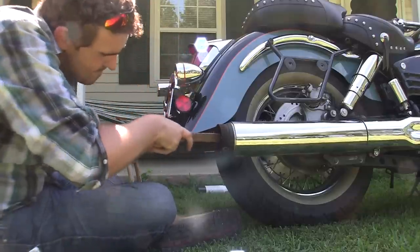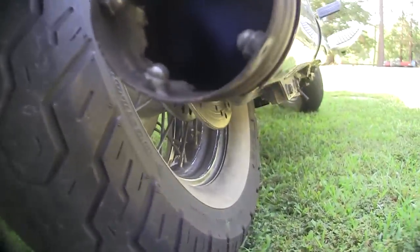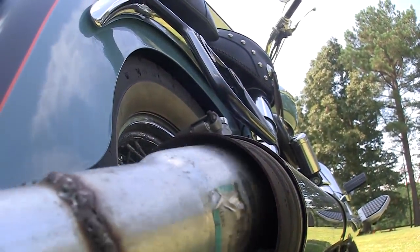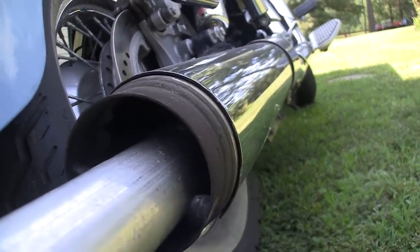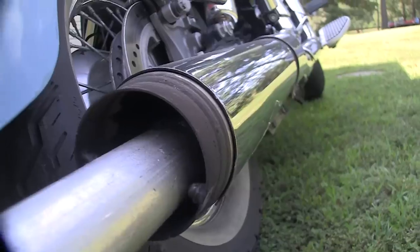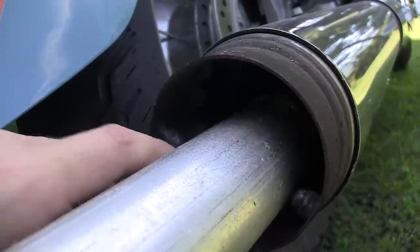It will give it more to grip. These little burrs here — this is where the old baffle was. You're getting kind of an echoey tin can sound because this is too big of a cavity in here. If you don't like that sound, that's why we're going to be going with this pipe. It's going to sit low, and you want to put it all the way back to where it will butt up against in there, but back it off a little bit so it's just resting on that pipe. Then you're going to pack that gauzy stuff all the way around this pipe to make a good seal.